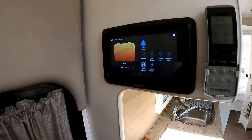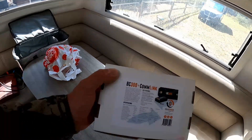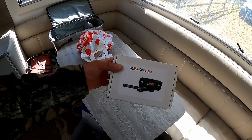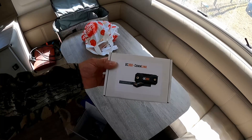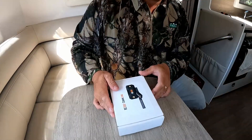So what we're going to do today is fit the BC300. That should resolve that issue. This is a smart shunt and goes directly to the battery, to the earth terminal. What it does is fill in the gap, so anything connected directly to the battery will be measured as well.